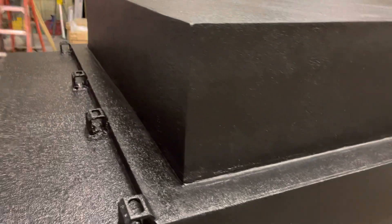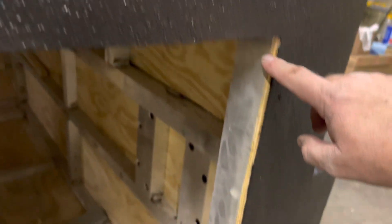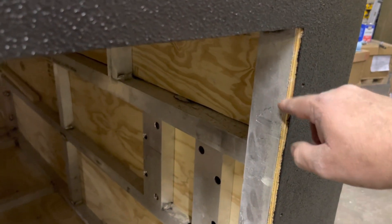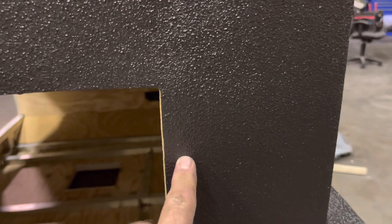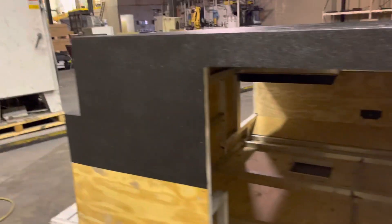All the way along here I used automotive-quality hardening rubberized caulk — you can kind of see the caulk line. This thing is straight up impervious to water on the bottom. I'm not worried about water getting inside from down there. Next I'm going to wrap Raptor liner all the way along the top edge as well so there's no way for water to seep in past the seal and get into the wood. This wood is going to be completely sealed, and the screws will have butyl tape over them. This thing is going to be sealed up like you can't believe.